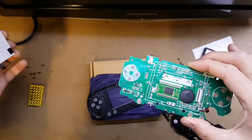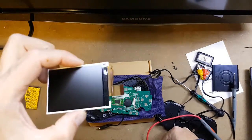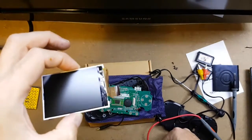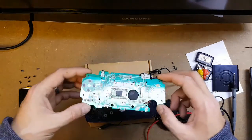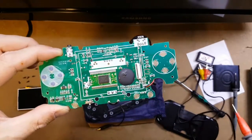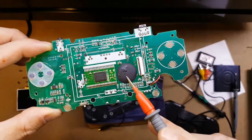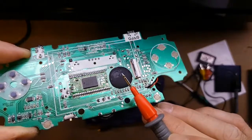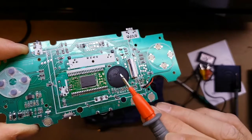Hi folks, back again — sorry about that, I had to change the SD card in the camera. The LCD itself is fairly good quality, as in the image it displays is good quality. What the SD card change allowed me to do was Google the part numbers on here. I was correct in saying that one of the semiconductors, the display driver circuit, is clearly under this blob of epoxy, which looks like it's had some sort of repair — because it looks like it's been painted on after, it's nice and matte, whereas this is semi-gloss as if it's been painted over the top.